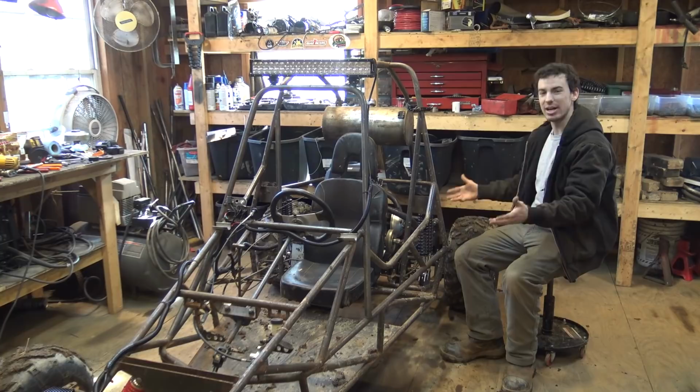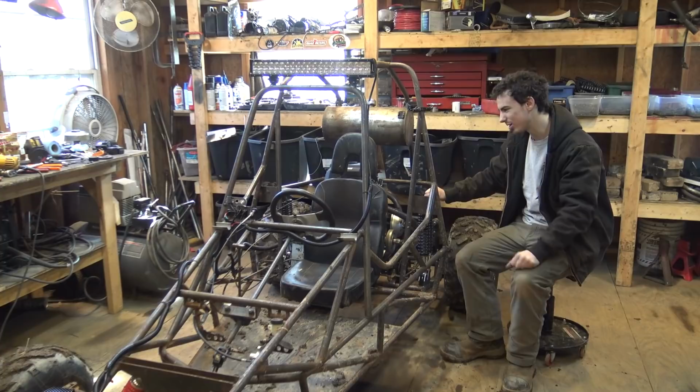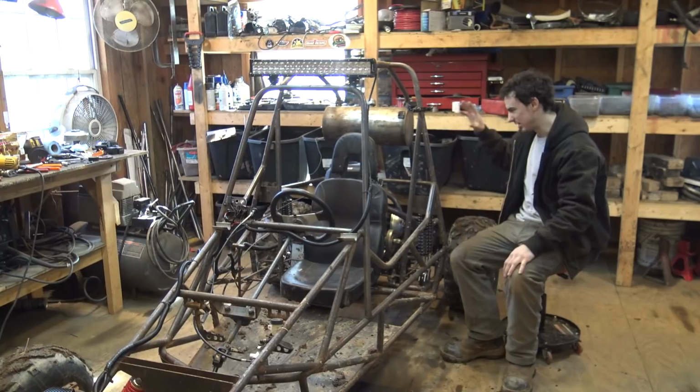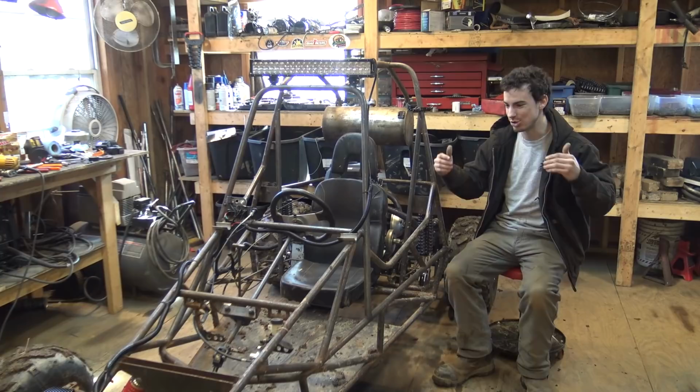I really want to take this thing off-road to see what this will do, how this will handle. But we've seen it with the smaller engine and the smaller torque converter, and it really just struggled the whole time off-road. It did pretty well for what this thing is, but it needed these changes. It needed a bigger engine, needed a bigger torque converter, and it needed semi-independent rear suspension. So now that we have that, I think this thing is almost ready to call it done, to finish this thing and finally paint this.